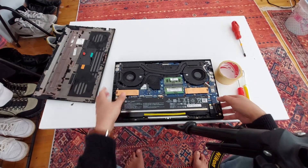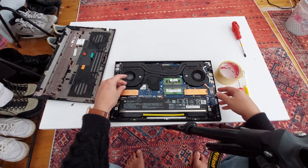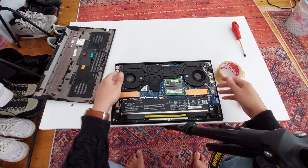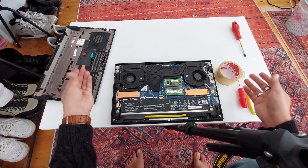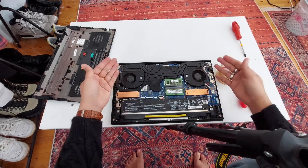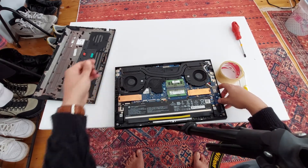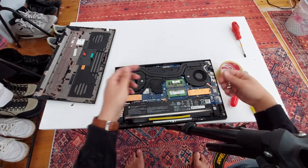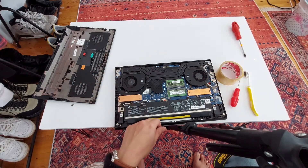The fans are pretty clean already — I'm happy with the result. It doesn't have to be super duper clean, but if you want it spotless, you may have to remove the entire heat sink and fans and truly clean it. You can also use compressed air for that. Anyway, keep cleaning with a toothbrush or any other brush, have the battery disconnected, and that's it. See you guys in another video!